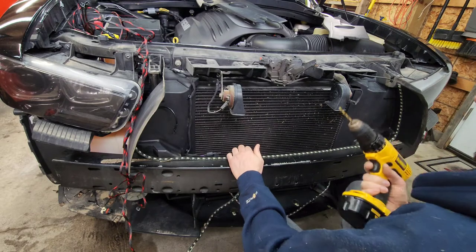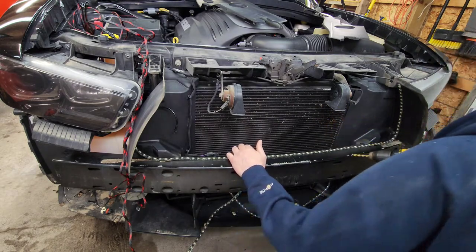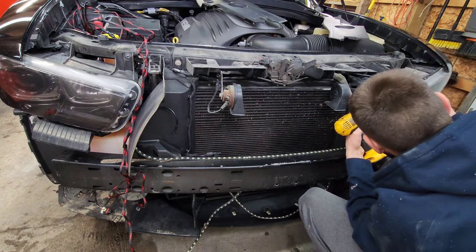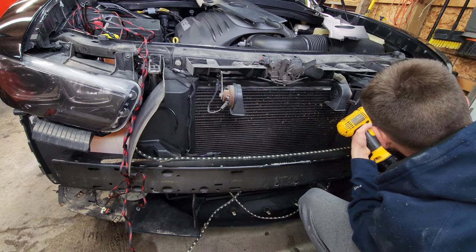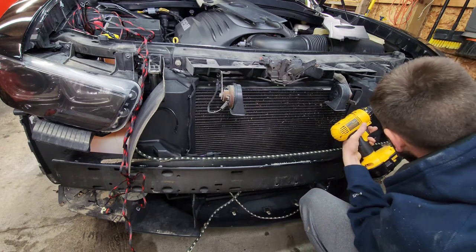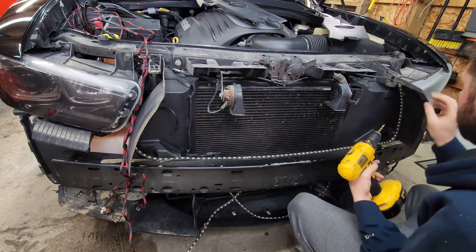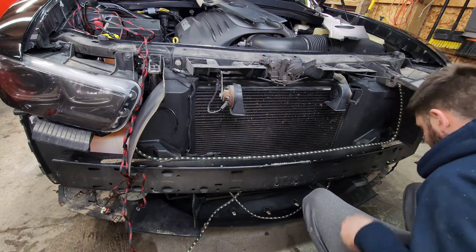And then I'll take a drill bit, 11/64. I'm going to drill a couple holes on each side of the light strip, and I'm going to install some zip ties just to hold it in place because it is double-sided tape. I haven't had a failure, but I also use some reinforcements to just hold it in place.